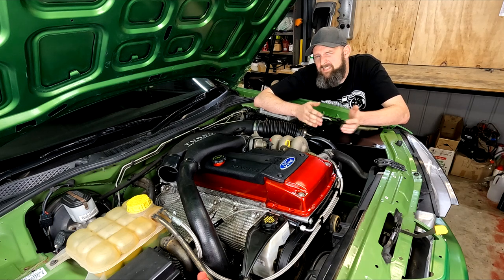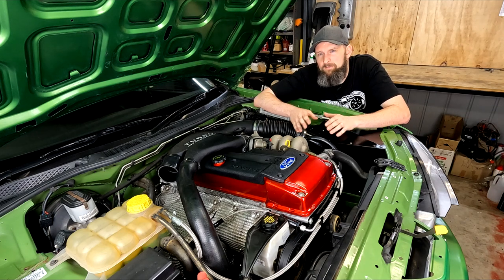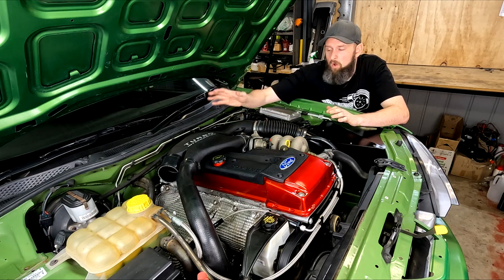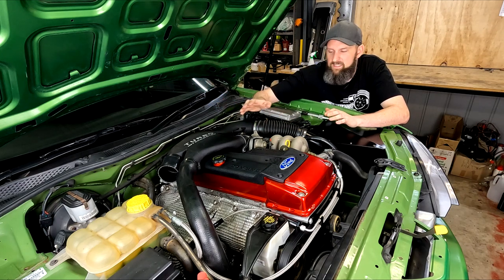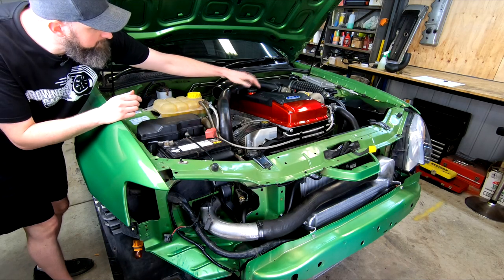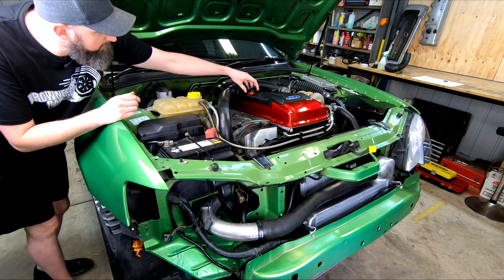The effect should be somewhat limited as long as we can build pressure in the system and we're mindful to ignore noises related to that, such as straight out the exhaust or the PCV valve venting into the intake. You could also remove the oil cap if you want to be overly cautious of the pressure in the crankcase.